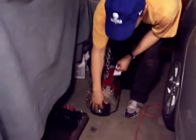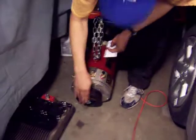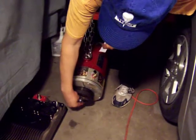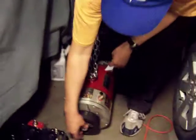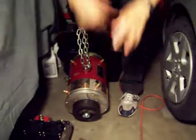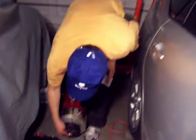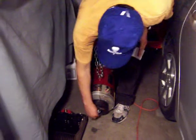When I built this plate, or I assisted in the building of this plate, I decided to build also the front pulley, and this is part of the old gasoline engine. Actually, I was able to find a hub for this where they fit together. I had to remove a little bit of the extra thickness of the hub to make it fit inside, but I was able to reuse it very nicely, and just with some welding it fits really good here, and a regular screw.